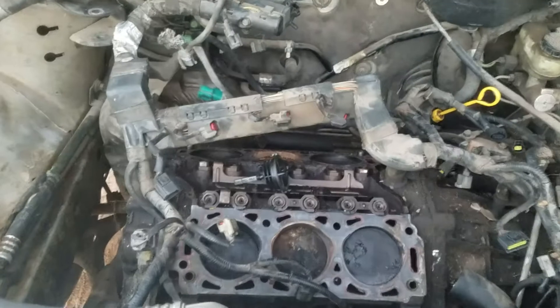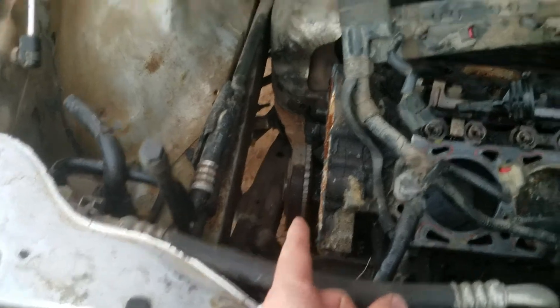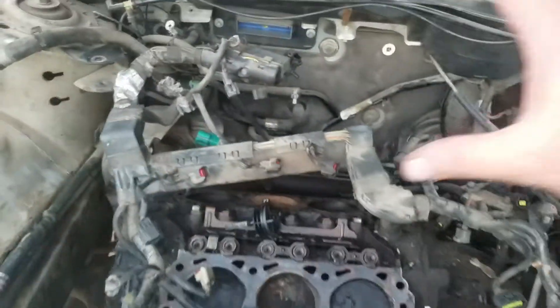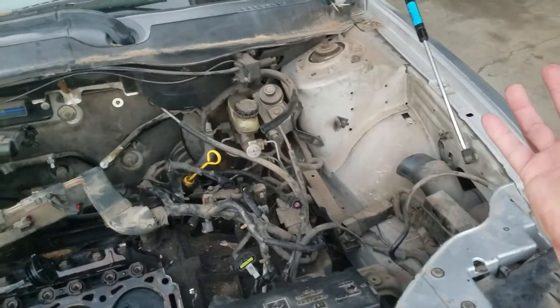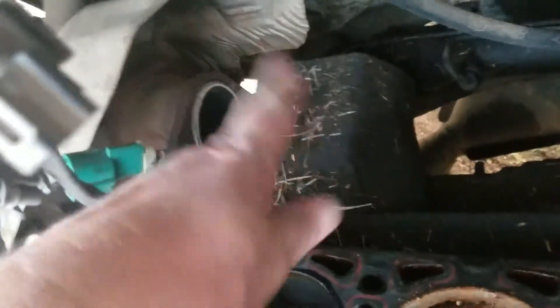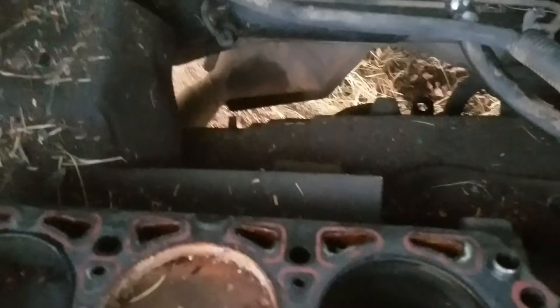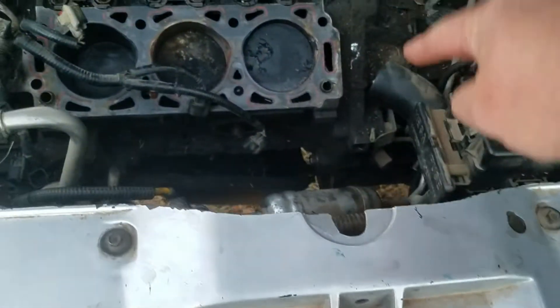Here's what we got: I've got the heads off both sides, the gears off, and the water pump off. I've got the wire loom pulled all the way back, unplugged from everything except the mount point. I've got to get both heat shields off, disconnect the exhaust — the two cats are loose — and maneuver around so I can get back here and loosen the back motor mount.